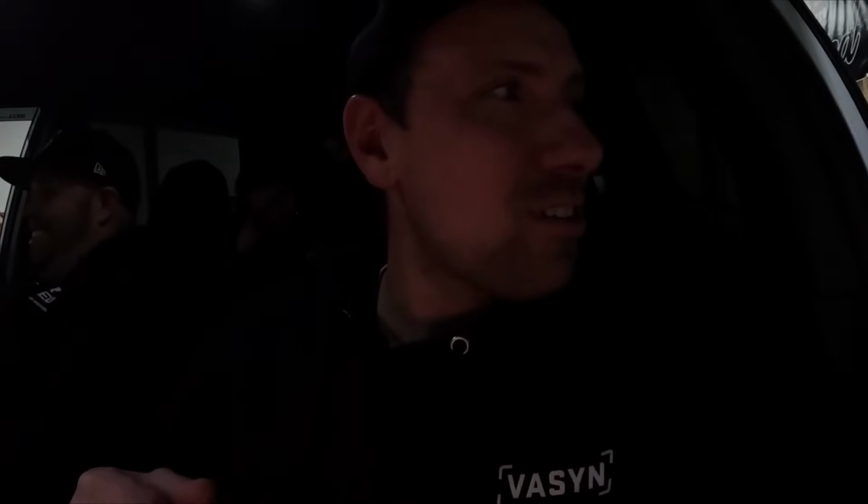But here we are, first pull, making a solid 604. How you feeling about that back there? I'm pretty excited with that. If I can honestly keep it there, I would, but you know, I'm not in control of the laptop, so I'll blame the tuner on this one. You know, this is going up right now. So we're gonna do another hit, see where things are, add some fuel, keep that cylinder cool. I pulled some timing down low to keep torque happy. I lowered VTEC a couple hundred RPMs to get it smoother in the graph. See what happens here.